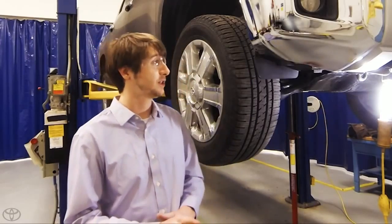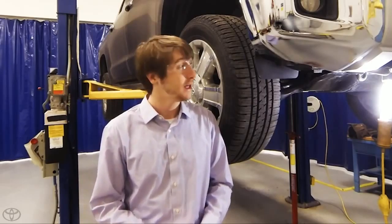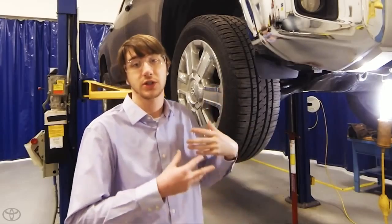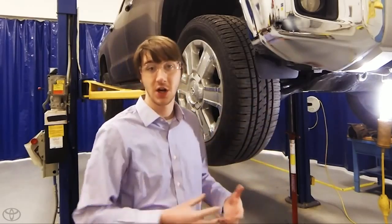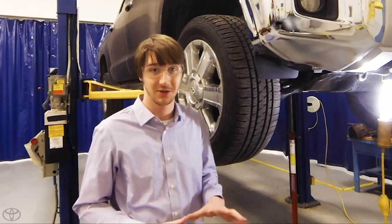Well, these forward mud flaps are actually called a SPAT. Believe it or not, they're an aerodynamic device. How they work is, as your vehicle is going down the interstate, you have to push a lot of air. And the tire tread and the suspension and many other areas in this region are not so great for air to pass through. It's a very rough surface and it's not so great for aerodynamics.